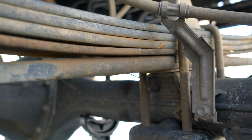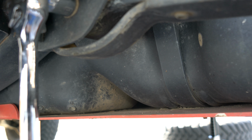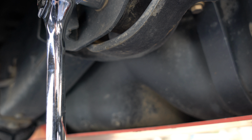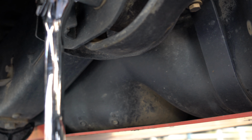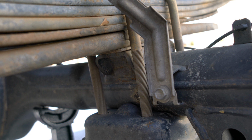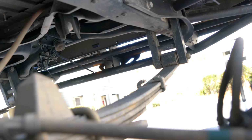So now I'm going to be removing the front bolt of the leaf spring pack, and I've never undone this bolt before, even though I've modified the truck quite a bit. I've pulled apart the whole leaf spring, added a leaf by Toytec, run by a coach builder, plus 3-inch shackle, but that never required me to pull this front end off. So this will be the first time, and it requires 19mm sockets to remove, so we'll go ahead and do that. And just kind of loosen this up first and keep the bolt in, then we'll begin to loosen the U-bolts and the rear shackle. And I'll probably go ahead and take the shackle off and re-grease everything so it's not all squeaky, so everything's kind of fresh and new.